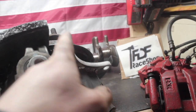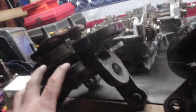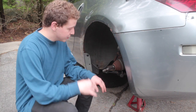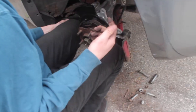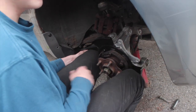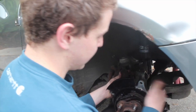The dual caliper brackets are welded on. I have the calipers with the new pads ready to go on, brake lines on both knuckles, backing plate, stock e-brake, and wheel bearing on it. I just have to connect the e-brake which might be a little bit of a pain, but I want to keep the factory e-brake. First thing is hooking up the e-brake, then we can throw the axle in and mount everything up. I ended up skipping putting the stock e-brake back on because it's seriously a pain and getting the axle in would have taken too long. Going to tighten this up and then start connecting everything.